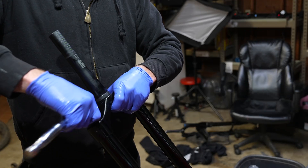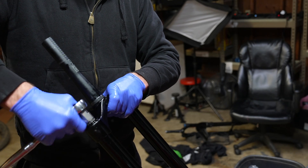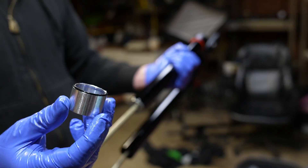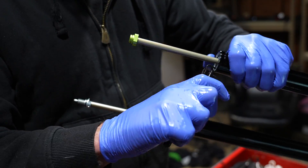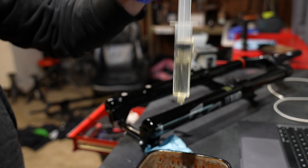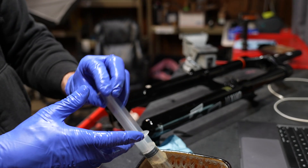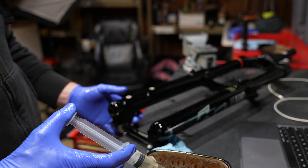At this point it's pretty straightforward — bolt the compression damper back into the fork with the cassette tool. Assembling the top CSU (crown steer unit) is easy: pop the air spring in, there's a little o-ring that seals it, put the snap ring in, and this thing is ready to go back together with the lower legs. Both lower legs get 25cc's of 7.5-weight oil — but make sure you reference the official chart for the correct oil to avoid damaging the seals.